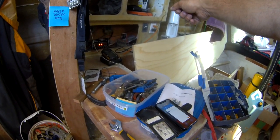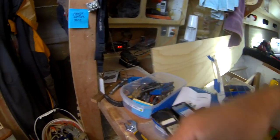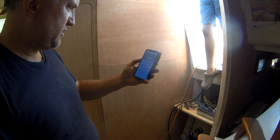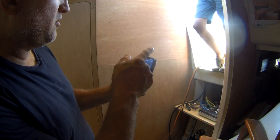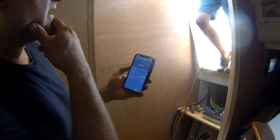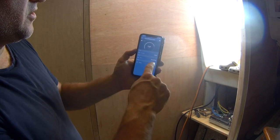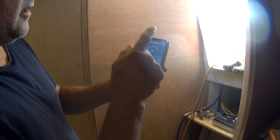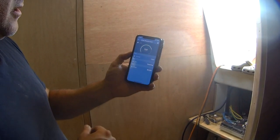So we're one step closer. I'm putting in a dual switch — one will be shore power and one will be inverter — so I'll be able to cut the inverter off and not give it any load. We've just got the temporary extension cord plugged into it and the vacuum. That vacuum uses 7.8 amps at 120. I just wanted to show what it does — turn it on, David. So it goes inverting and it went right to high. The output of that unit is only 8 amps, so we're using 7.8 — pretty much using the whole thing.